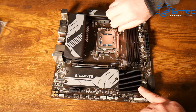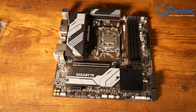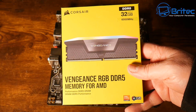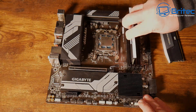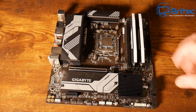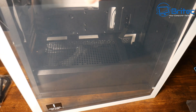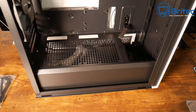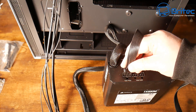I've already removed the plastic mounts that come with the board, and I'm going to put on the mount for my all-in-one cooler from DeepCool. Then we can put in the memory — you can go with 16 gigabytes if you want, but I'm going with 32 gig, which is pretty cheap nowadays. I've already connected the CPU cable, so let's remove the side panel to gain access to the inside of the case.